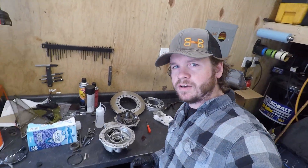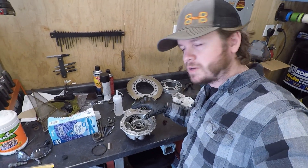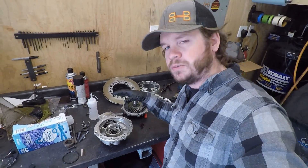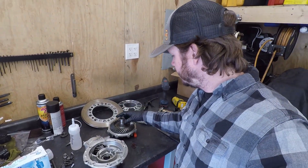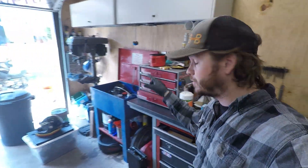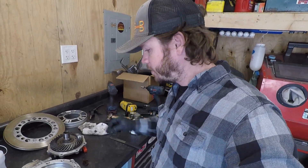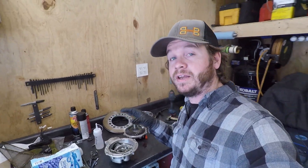Cleaning stuff up — got the diff here. I'm not going to fully disassemble it, but as I normally do I at least opened it up to clean out the old oil residue, check the gear mesh, and make sure all the bearings spin free and don't make any weird noises. Been cleaning the pieces in the solvent tank. They're ready to go back together — a little sealant, throw them back together, get it as an assembly, and then I'll paint it.